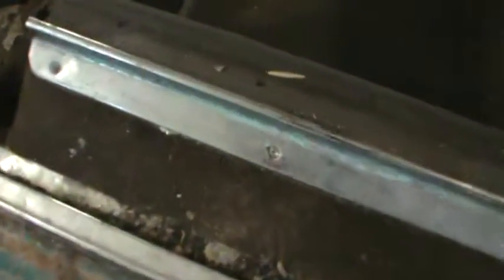This is where the seat goes, and that chrome piece is hard to get out because those screws right there are probably frozen. I'll have to drill them out with a left-hand drill. The center section of carpet comes out on the rocker, and then you've got your rear section of carpet here, which is overlaid again by the chrome and the rear interior panel, which is in pretty bad shape. And then again, you've got another decorative vinyl piece with that chrome right there, which is riveted. Drill those out. And both pieces have this flexible pull-out strip that holds everything in place, that just pulls out after you get out this chrome.